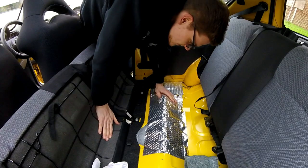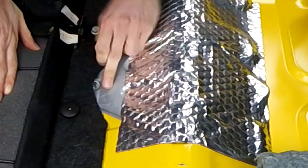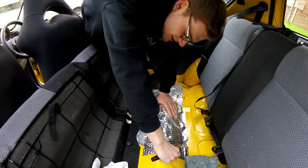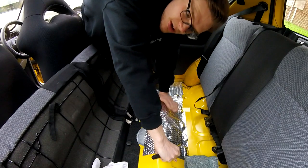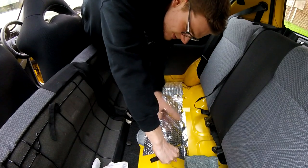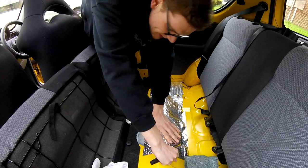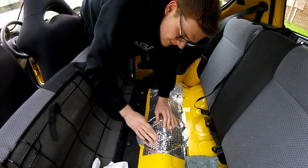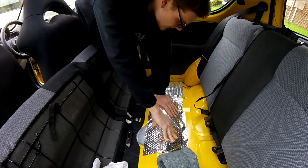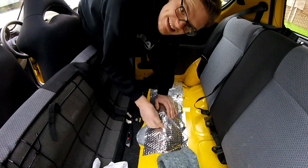That's one from start to finish. That triangular silver metal plate you can see there — that's how you get to the fuel tank, that's how you get to your fuel pump. With anything you do to your car, it's best to make sure that if you need to get to any other bits in the future — to modify or upgrade — that access is still usable. I've cut this out so we can still get the protective plate off, still get to the fuel tank, to the fuel pump, to all that stuff — when this thing is making more power and needs a bigger fuel pump. You've kind of seen how I've done it with these two, so now I think you should see what it looks like when it's done.